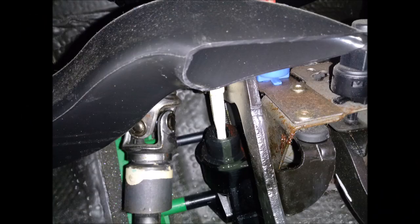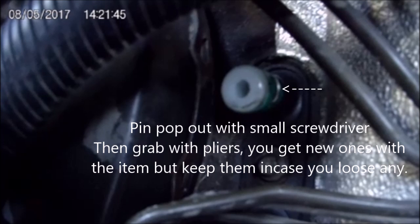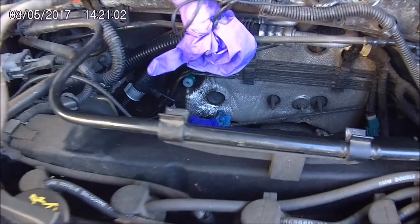Going back to where we are: we've gone underneath and unbolted the two bolts holding it onto the clutch pedal assembly. It looks like you might want to take the assembly off - I wouldn't bother. The only problem is the steering column blocking you actually pulling it out into the car. So we've disconnected the two screws. It's then got two sort of slide mounts - we're leaving them in for now. Go to the engine side and pull the two little pins out that secure the lines, and have something ready to clog the lines with.